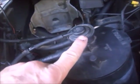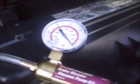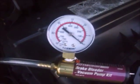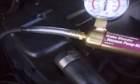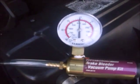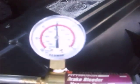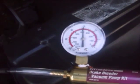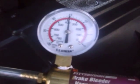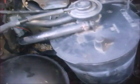Take the top hose off the top nipple of the purge valve, then connect a short hose to your vacuum pump — I got mine at Harbor Freight for about $20. Pump 15 inches of vacuum. That should hold for 20 seconds. If it does not hold, you've got a leaky canister and you'll have to replace it — there's no way to fix it. I've already ran the test and it holds.